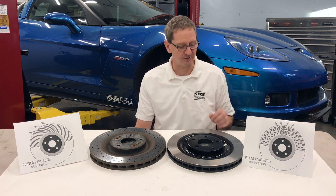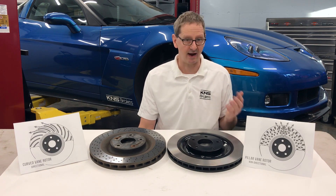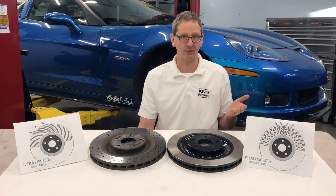The iron that Discbrake Australia uses is an alloy — it's their proprietary mix — and they also heat treat these rotors after production to improve performance. So we highly recommend these for track use, and we have a good history of these on Corvette cars.